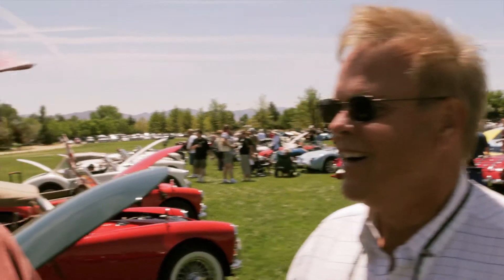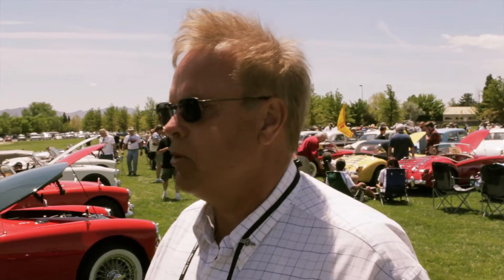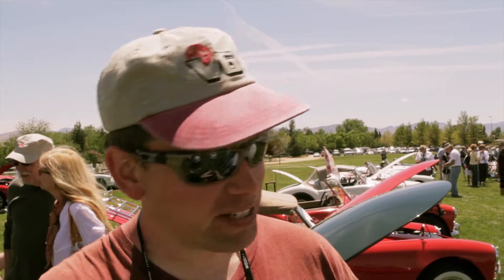Same rear end, same gear ratios? Bob: No, the rear end is an MGB 3.9. This came with 4.10, actually. It's just a pumpkin, not the entire MGB. And actually, I sold the one that came out of it to a guy in Australia — I think he was putting it in a Mark II; he wanted to gear it down. A Mark II has a 4.10, and the other ones had 4.33s. It's always the newer cars' components being swapped into the older cars — the MGB rear end ratios going into MGAs, MGAs' ratios going into T-Series.